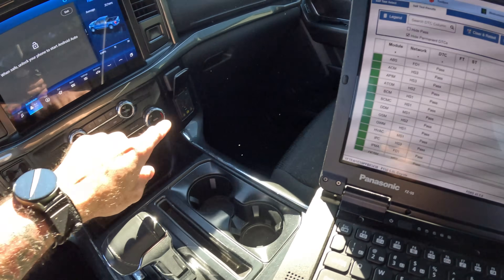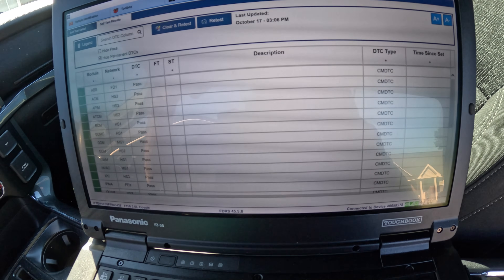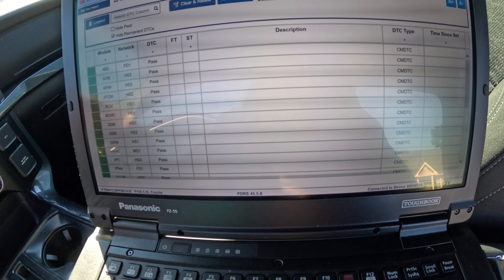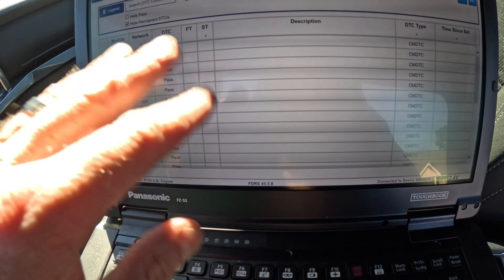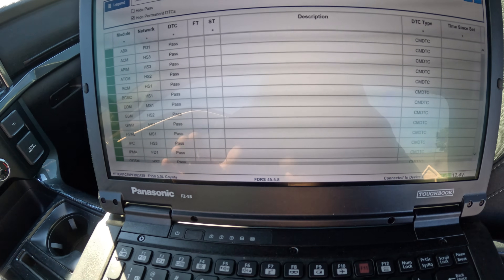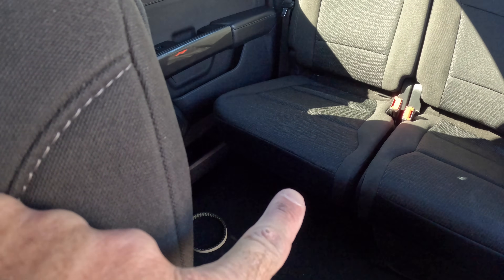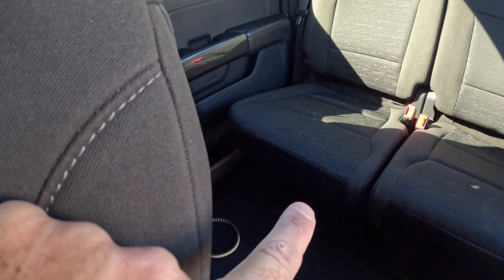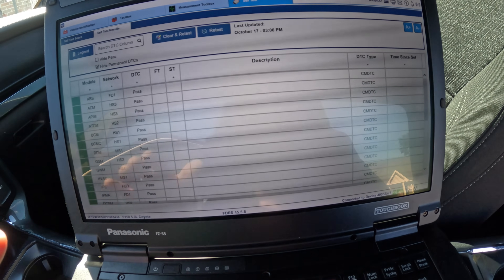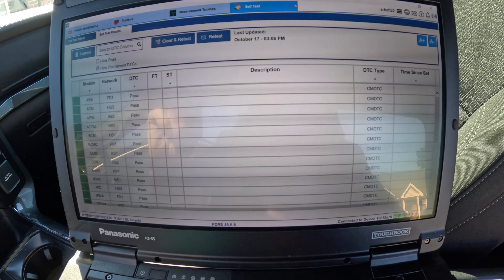So if you are having a problem with your front outlet — the 12-volt up here, the back one, or the one in the tailgate — none of them are lit up, then more than likely you're going to have to replace that tailgate connector. I also have another video talking about what I just went through in here, and I'll leave that up in the description. That fixed the concern — easy fix, the part was only like 60 bucks. At least it wasn't an inverter, because the inverter by itself is $500, or you can get it with the plastic tray it comes in for like $200 — but we are fixed. That's how you fix the concern, that's how you get the power outlets back on. I appreciate you guys watching — as always, like, comment, share, subscribe, and I will see you on the next one.